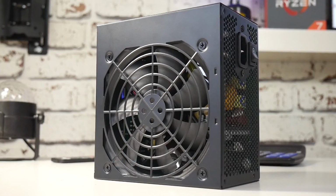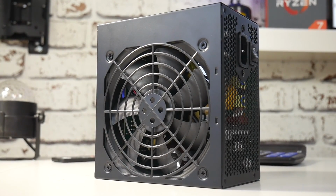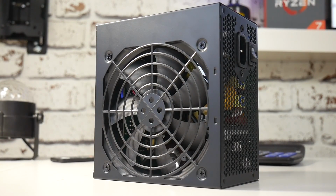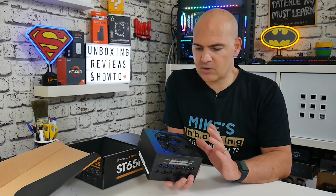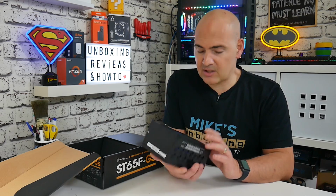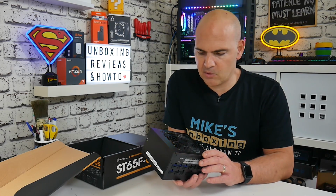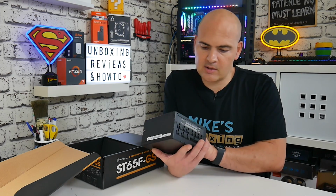So that's a 120mm fan, and as you can see, there's a little bit of a gap on the side there. So 120mm and about another 20mm on the side, maybe just slightly under. I think it's 157, I think I said earlier, as the standard width of an ATX power supply. So, nice fan. It's a sleeve bearing fan, so not perfect, but again, perfectly usable. And you've got a nice ventilation grill on there to let airflow through the system.